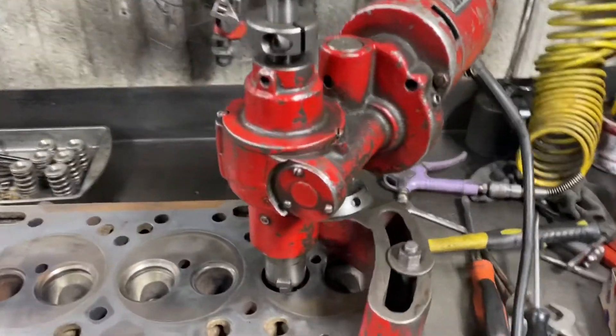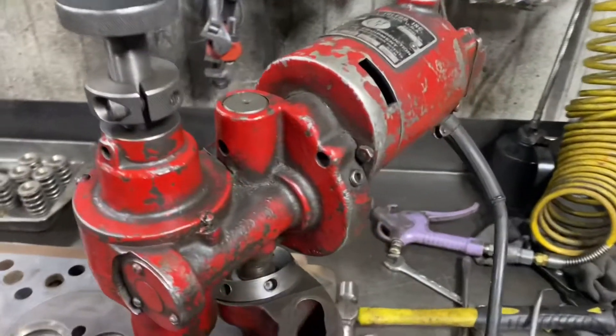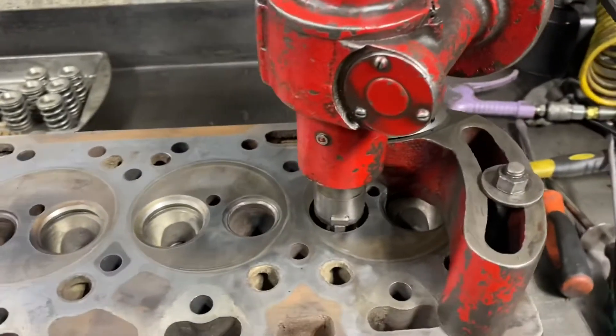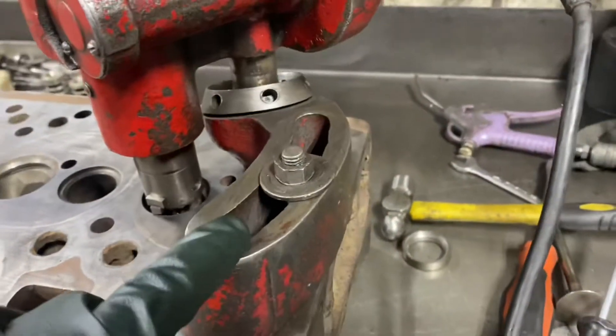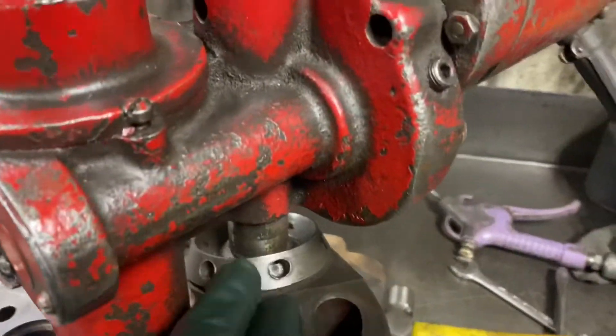I've got our PM mounted on our cylinder head. This is a portable seat cutting system — we use this for a lot of flathead engines, and on jobs like this where you get something weird or oddball and don't have the right size cutter, we get this old girl out. Pretty crude setup — you just mount it to the head with a homemade stud setup and tighten up this guy here on the little ball.